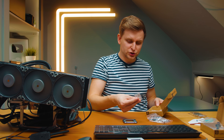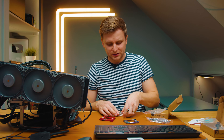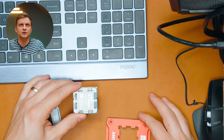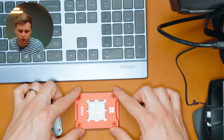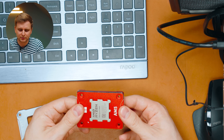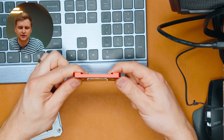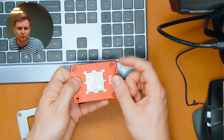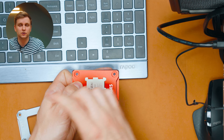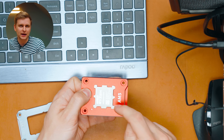There is also an AM5 version, as you can see — same thermal paste and Torx key — plus screws and the AM5 bracket. Interestingly, this one is heavier than the Intel one, but it works the same way: the bracket goes over the CPU and holds it down. The IHS is slightly higher than the contact frame, but I don't think it's as big a deal for Ryzen.